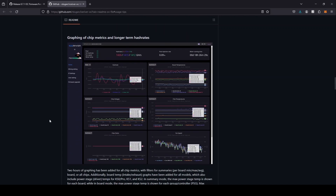Follow all of these instructions. It can be a little overwhelming when you look at the updated web GUI — there's a lot going on — but when you look at it and tweak things, it will make sense to you. Here's your hash rate, your board temperatures, chip voltages, chip temperatures, fan speeds, chip clocks. There's a lot of data and information. So get to know this web GUI and take your time.